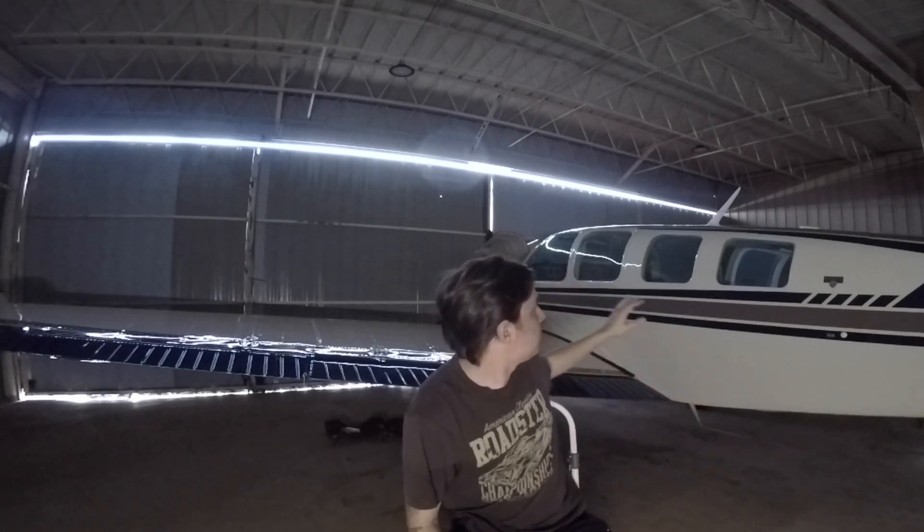First things first, I'm going to apologize for the birds that are apparently making a nest or something in the hangar right now and making all kinds of noise. I'm going to get right into it and talk about what is a compression test and why we do them. I'm going to start by pulling this airplane out, getting it ran, getting it good and hot, and then bringing it back in the hangar. I'll probably start the oil change, and then at the same time that the oil is draining, I will do the compression checks.